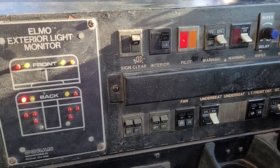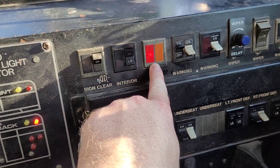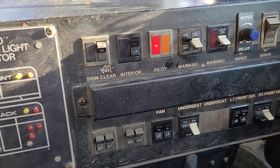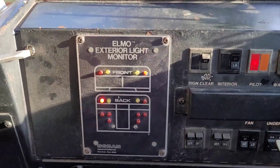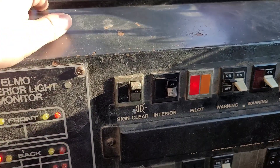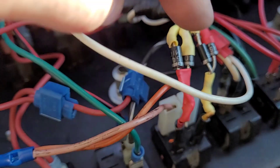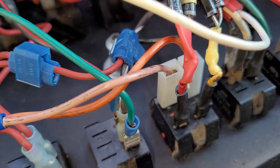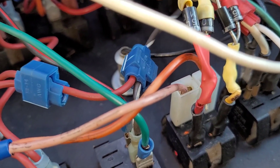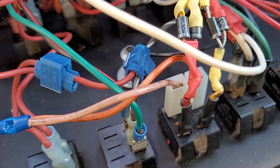Hello YouTube. A few weekends ago I hooked some diodes up to my pilot light here so it would work again the way Thomas pilot lights worked. Let me pull these screws real quick and open this up. If you look here at the back of our pilot light, notice I have these diodes here. The reason being is the bottom wires go to ground, which actually grounds to the light monitor. The way this worked with incandescent lights is both positives came to the pilot light.